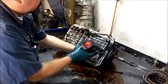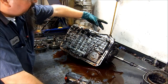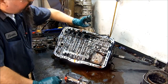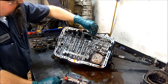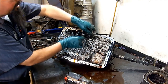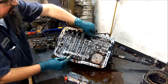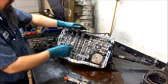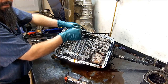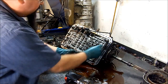We were removing the linkage arm with the nut and we held it with the pliers. Why did we do that? Because if you put your impact wrench or any kind of wrench on it, you're going to go all the way down here and this rod right here — if you put pressure on this rod, you're going to break it. You're going to break this rod and you're no longer going to pull your manual valve. See how it holds the manual valve and pulls it in and out. It is very common for the 5R55W, the 2002 or 2003 and up units — it is more critical and more brittle. If you don't hold that lever, this will come off.